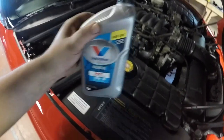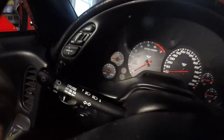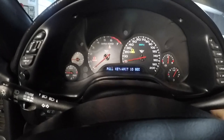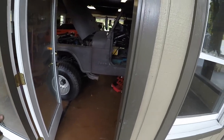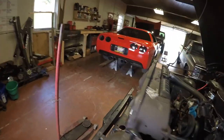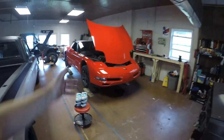We're filling it up with six and a half quarts of Valvoline VR1 Racing Oil, high zinc content 10W30. Got all the fluids topped off, oil filter in, and checked over everything. As soon as I start it up I want to make sure oil pressure comes up almost right away — if it doesn't, we obviously have a problem. We had a successful first start with good oil pressure right away. I'm going to let the car warm all the way up, then turn it off, let it cool down completely, and repeat that a couple times so the new valve springs can get heat cycled. Oil pressure looks good in the top left — normal levels.